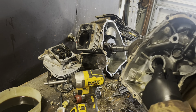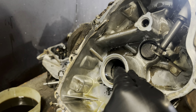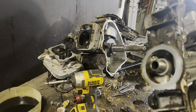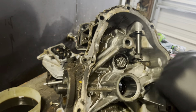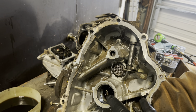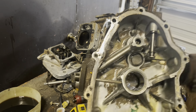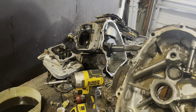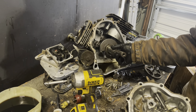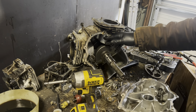There's a little hole right in here — the oil filter goes right there. Oil comes out of the pump to the oil filter, gets filtered, and comes into the crankshaft journal. That will then sling oil around the engine. The big benefit is that it will also run through the innards of the engine — and I'm leaking honey oil all over the place.